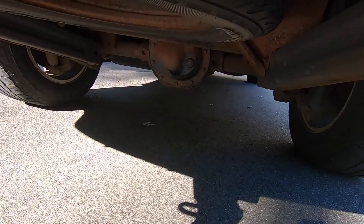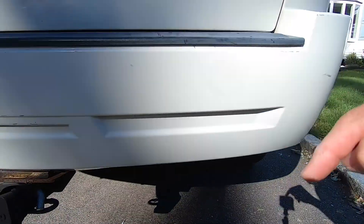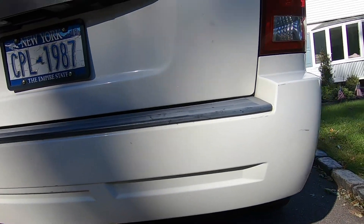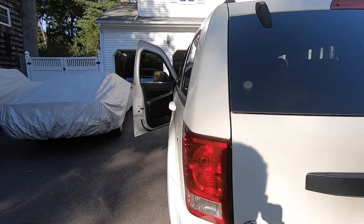One other issue: at highway speed you get a humming noise coming from the drivetrain, and when you're coasting it kind of goes away. I checked the rear differential — there's a little plug for the gear oil — and it was a little bit low. Usually it's filled right to the bottom of the hole, so I topped it up with some gear oil. Next chance I get I'll take it on the highway to see if it makes any difference. I doubt it though — it's probably just bearings wearing out. The car is pretty old with almost 160,000 miles, so it could be bearings going bad in the rear axle assembly.